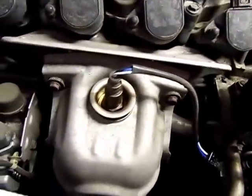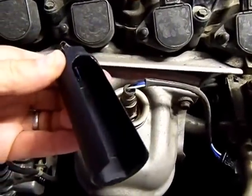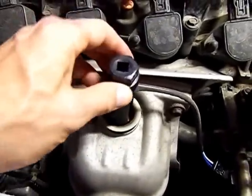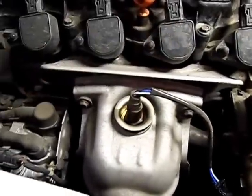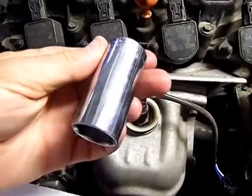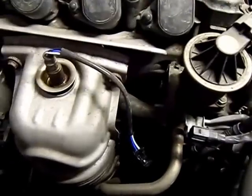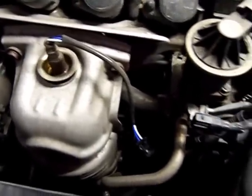To remove the socket itself, you can either buy one of these from an auto parts store — it's a 7/8 inch socket with a side cutout so that it fits over the sensor and allows the wire to hang out the side. Alternatively, if you want to save yourself a few bucks, you can just get a 7/8 socket and use an angle grinder to cut out the side of it. Make sure you use anti-seize lubricant or the thing might be really tough to get out again next time.